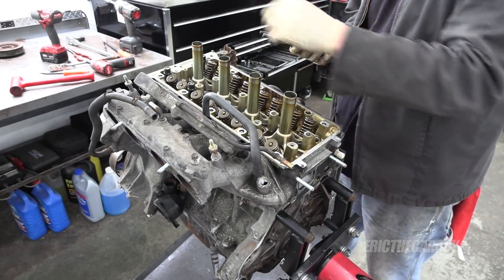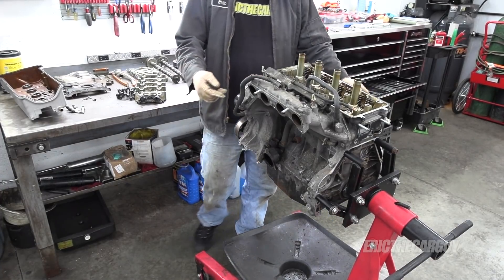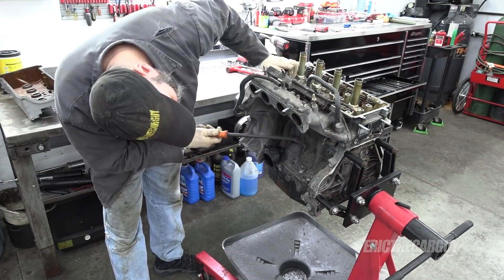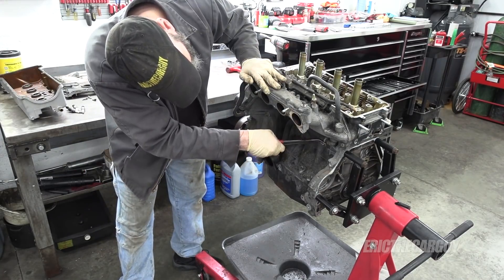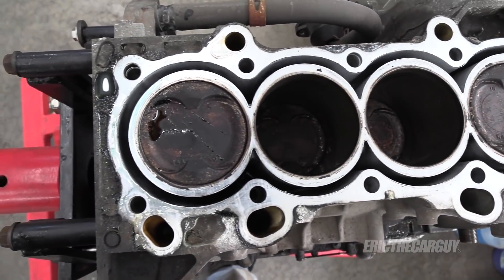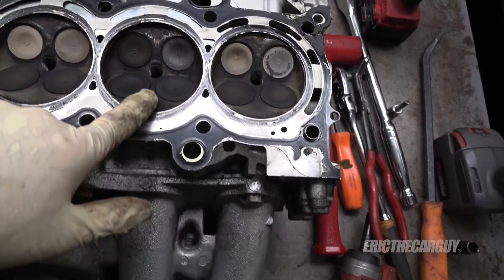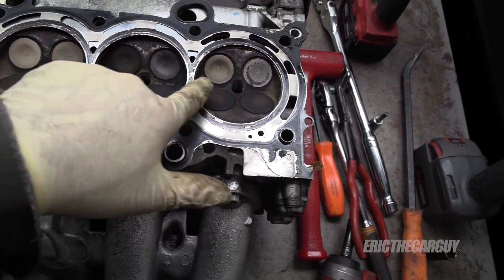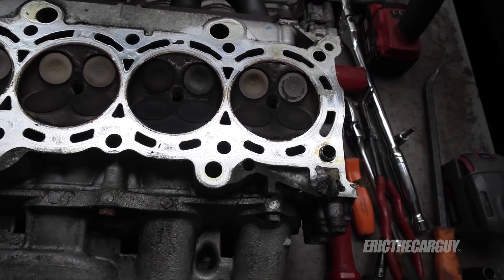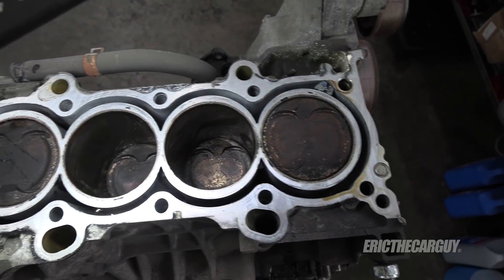These are all the same length. I'll be honest — I don't know if they're torque-to-yield; I don't see Honda using that a whole lot. Another thing about leaving this stuff on is it gives me a bit of leverage on the cylinder head. These look good for the most part. This looks like an old engine. Valves also look pretty good in normal, except for cylinder number two — see how the exhaust valves are darker here than they are here? So we definitely have a problem cylinder.